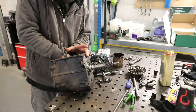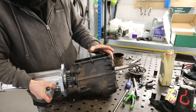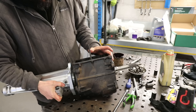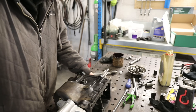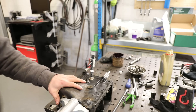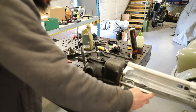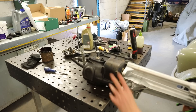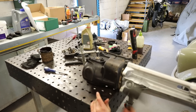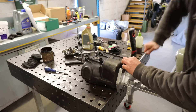Just making sure I've got the fourth gear synchro ring on there, and the cage needle roller bearing that goes in the end of the input shaft. Then you just have to carefully slot everything into place. There's a little recess on the tail housing that allows you to feed the lay shaft spindle in. Having that rubber tube inside the lay shaft made it quite easy for lining up the lay shaft - I could just get a screwdriver into the centre of the rubber tube from one end, then eyeball it and line it up from the other end. Then once it's lined up, you just push the spindle through and that ejects the rubber hose out the other end. Then that just taps into place, and you can rotate the tail housing back around and it just slots in place.